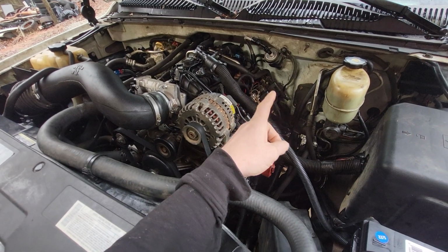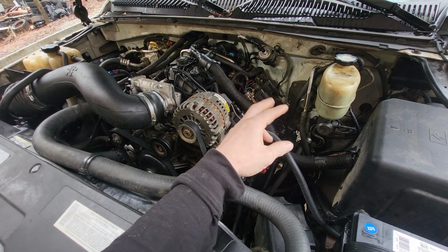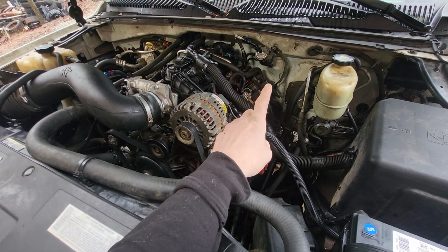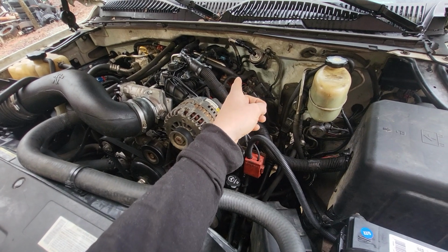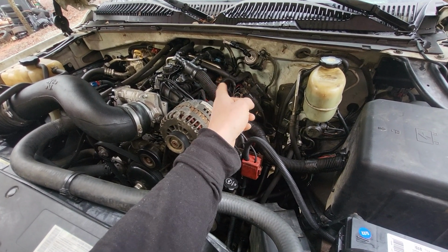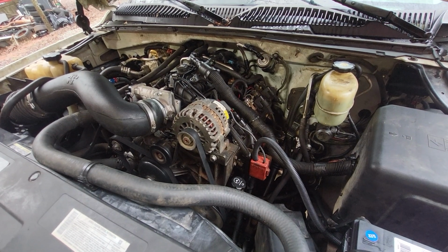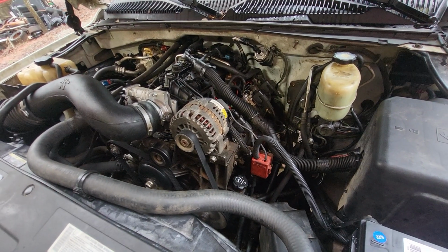That's the fuel setup I did with the Vette style return filter just to get it hooked up. So I actually just plugged it in. I was able to bolt right there, and then I had a fitting that went to a -6, and then put the -6 on the stock fuel line, and then used the fuel crossover hose that came with some intake kit or something I had. So I got that on there.